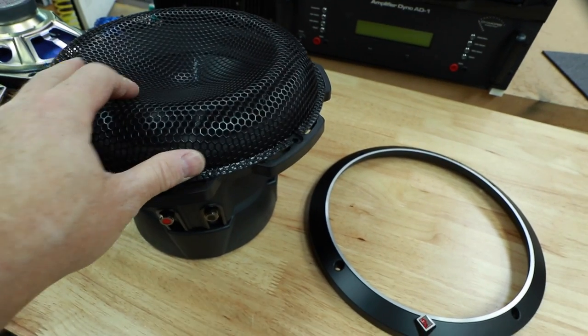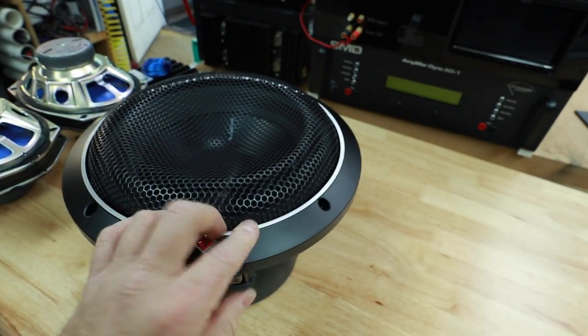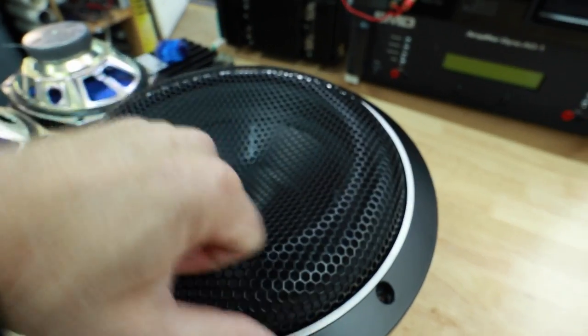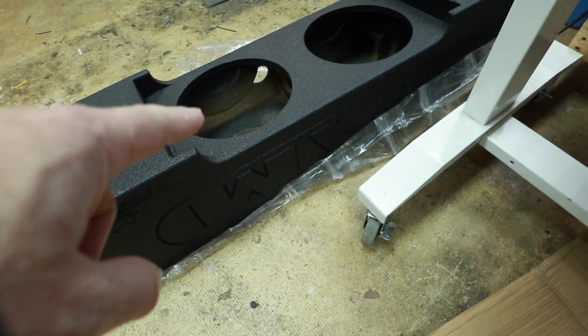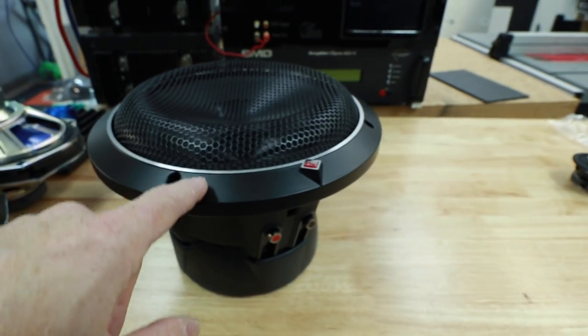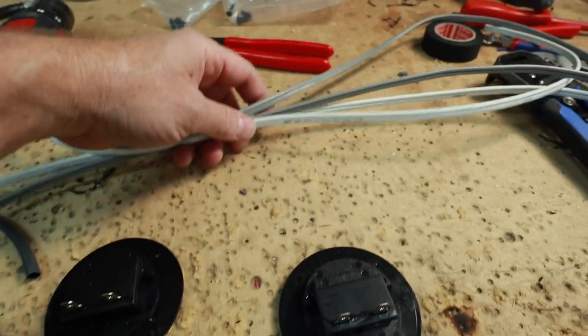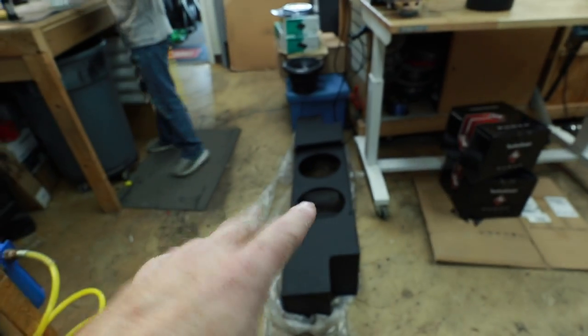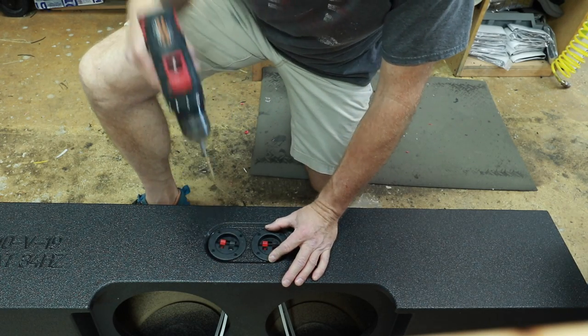One of its cool features is the unique basket design, which gives us the ability to use these cool grills. The grills set onto the speaker with four notches that line up with the through-holes, then the cover sits on top for a nice heavy-duty grill. This is the Fox Acoustics box for this truck — it has the Ram logo and it down-fires, which is even better because we don't have to worry about something getting caught under the seat and hitting the woofer. The speaker cups are ready on the bench with wire — I'll solder these up and get them into the box. These boxes do have Rhino Liner on them, so it's a good idea to pre-drill the holes.